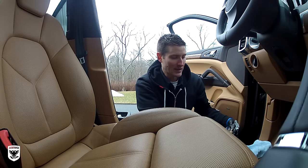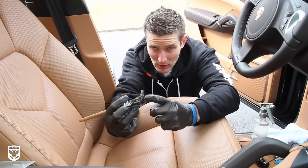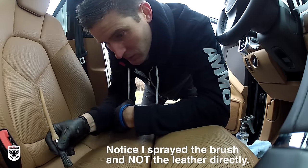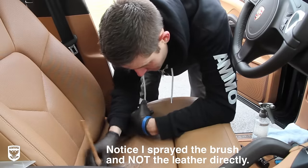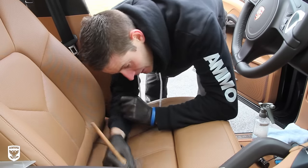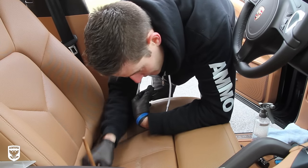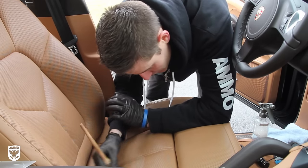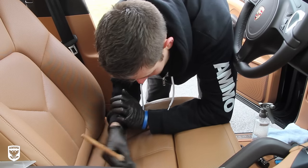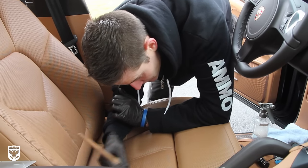Well, you do the same thing. Since it's not that dirty, I'm using my product — ammo lather. I sprayed a little bit into the tip of the brush, then I'm going to use little circles just like this. As you can see, there's a bunch of suds coming up, just like there would be on normal leather, like the leather around the edges here that's not perforated. Now if you had a steam machine, that would not be a bad choice either, because steam puts down very little water, which is the goal here — to avoid excess moisture. I've basically agitated everything, and with the little brush you can actually get inside those holes just slightly.